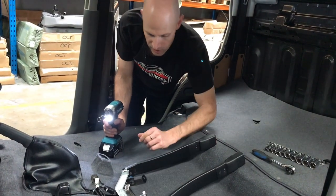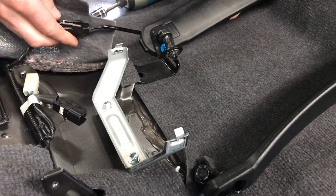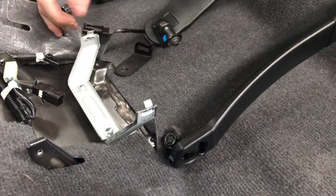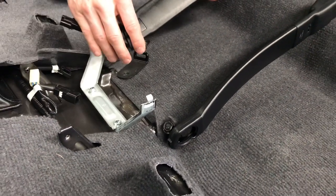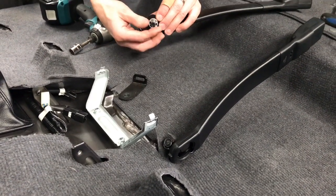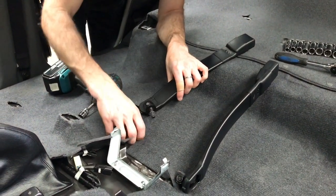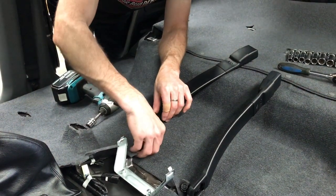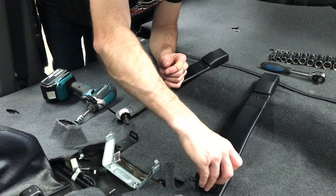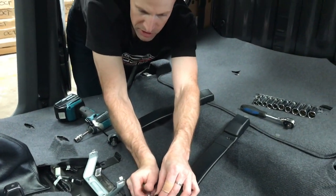For the carpet we want to unbolt these two seatbelts. This one's got a plug — just press it in and pull it out. All this does is read your seatbelt warning light, so your car won't beep at you. You can keep these bolts in the mount — they've got a retaining captive washer that'll stop them from falling out so you don't lose them. Note that the driver's side one had a mount running rearward of the car; the passenger side doesn't seem to have one. Be careful not to lose the spring-loaded washer — just spin it back on.